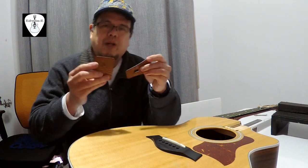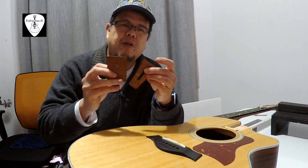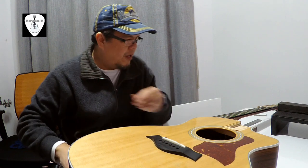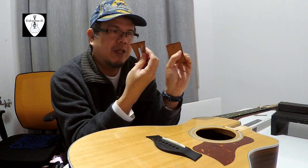I got the original shims with number 6 and number 12. According to Taylor, the combination should have a 6-unit difference — for example, this is a 12 and this is a 6, so 12 minus 6 equals 6. If I have another combination like 18 and 12, that's also a difference of 6.